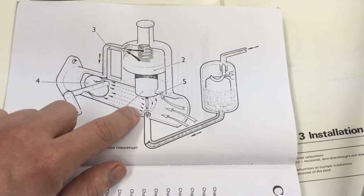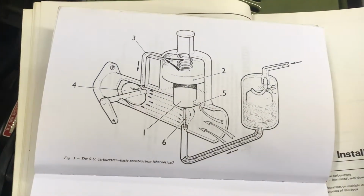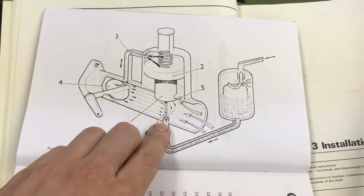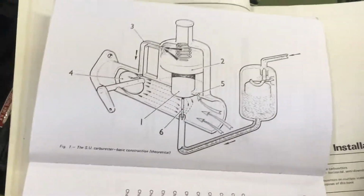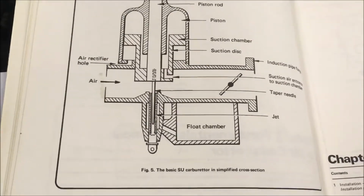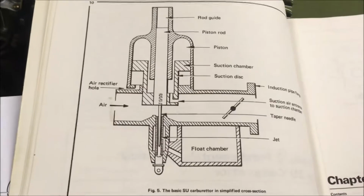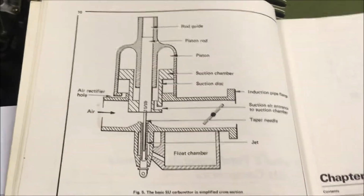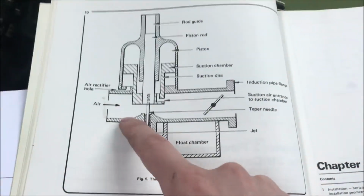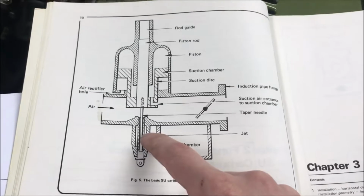And you can start to see how that impacts the air to fuel ratio because of the needle tapering that I was talking about before. So another thing that I wanted to talk about is how this needle operates and actually mixes fuel. And I think you need to look back at this chart again to really get an idea of it, because it actually shows this little rise at this point where the needle inlet is.